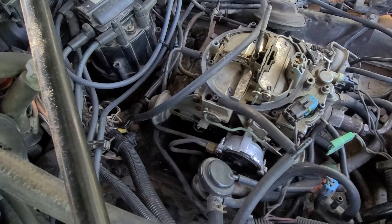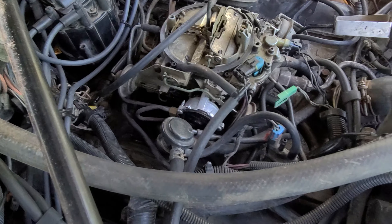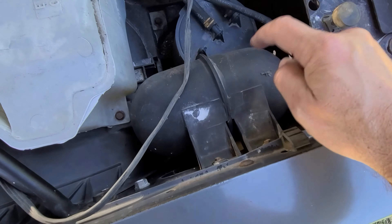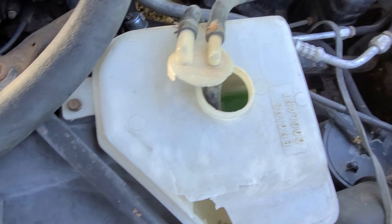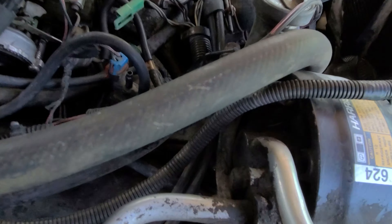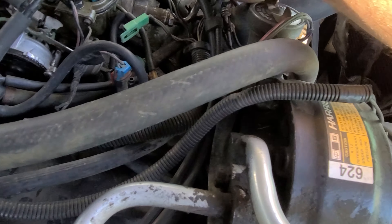This is going to go to the internal accessories, so that'll operate the brake release and the HVAC system. Then that's going to be teed off to this, which is a vacuum tank. I'm gonna hook this into there. Then the cruise control — the old-fashioned way — is meant to actually be spliced into the anti-diesel solenoid circuit, so I'm just gonna do that.